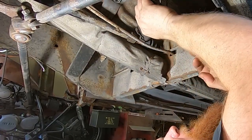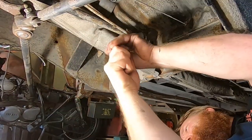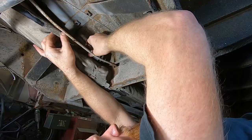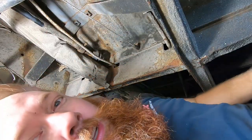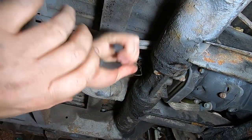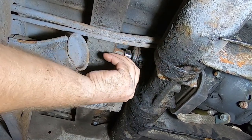This is safety wire here. I'm going to snip that and put some stainless steel safety wire back in when we reassemble. Eight millimeter here — it's probably got a dog point on it and it goes into a detent. This guy has to go backwards to get the other guy out. Same deal back here with the safety wire. Look at that — that was loose. That'll put some slop in things. That would have added a significant amount of slop.